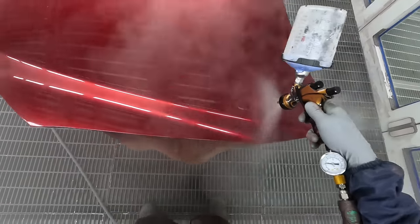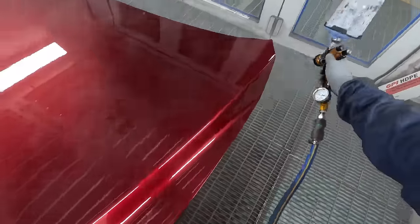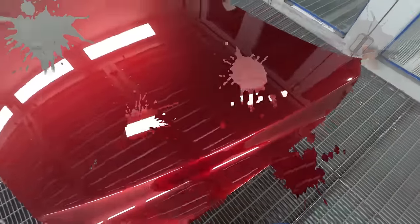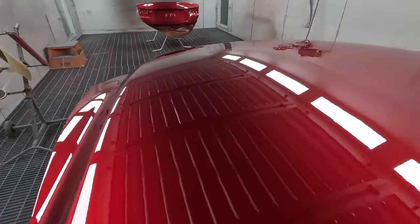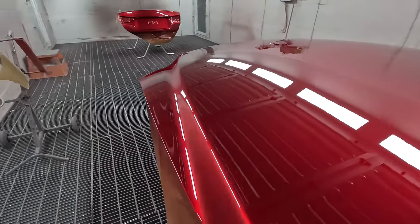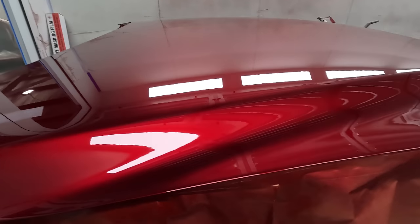You could go with the 1.2 or the 1.3 — the C2 would be best for most people. As far as the base coat gun goes, I would actually prefer one of these in a base coat gun over a clear coat gun. For the DV1 as a base coat gun, I think it's the best on the market. The DV1 base coat gun with a 1.3 and the B-plus air cap is the best base coat gun on the market — massive fan, impeccable build quality.